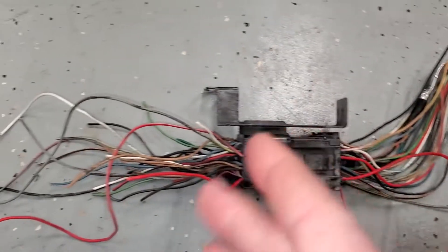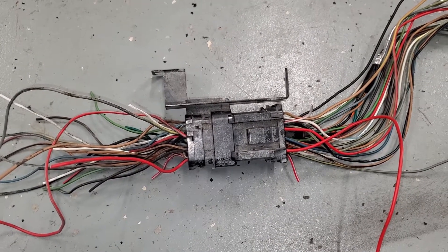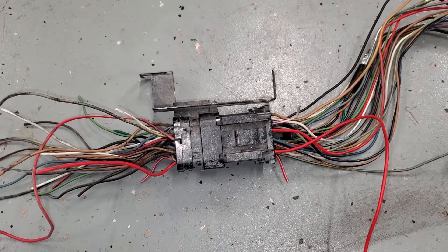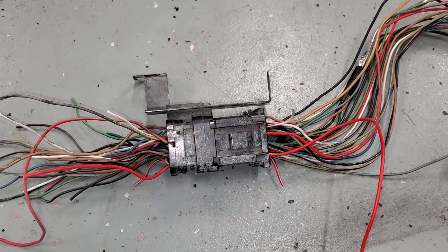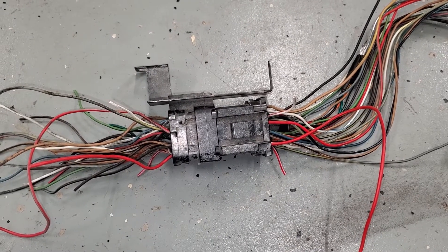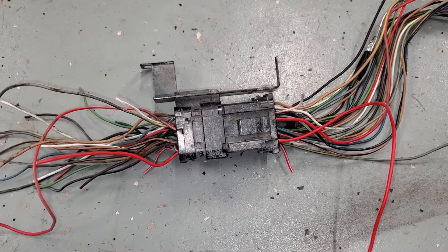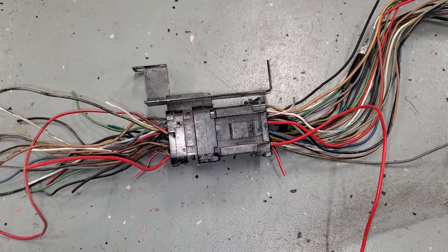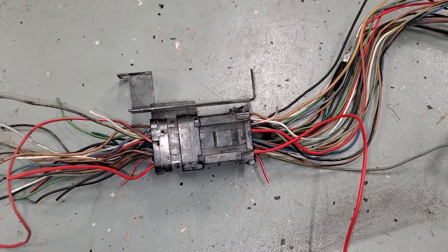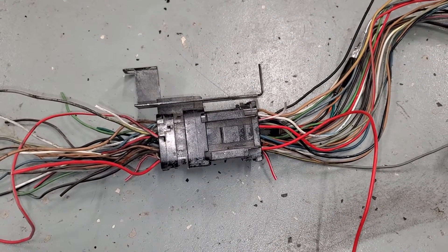For the tach you don't need to save the engine side - you just need to cut the car side and hook it to your MSD box. That's it - your gauges are done. You don't need to go into the car or find out where they go through the firewall. The rest of the wiring is undisturbed. The wires you need in this connector are on pin 31, pin 6, and pin 34.